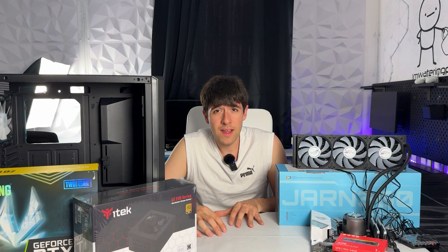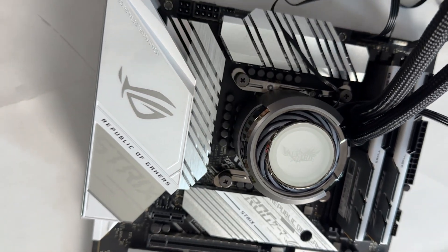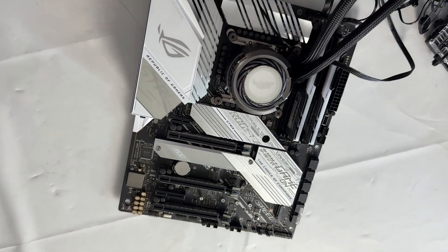He was told he could have paid to fix it, but he just didn't want to hear about it and just wanted to get a new one, so he gave away for free his old motherboard, CPU, and RAM. What we have right here is a ROG Strix Z490 which doesn't work - it did have thermal paste in the socket, bent pins, and a corrupted BIOS.